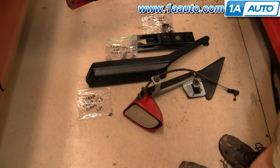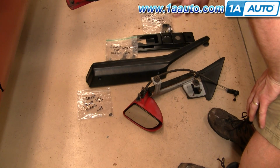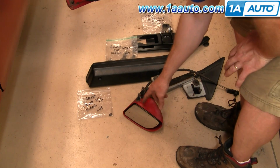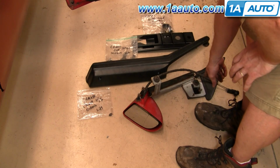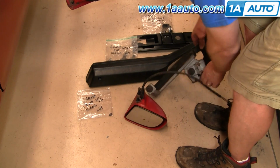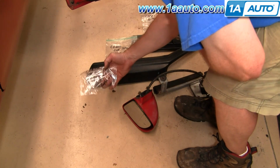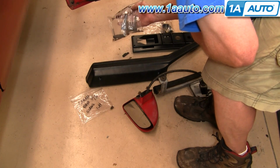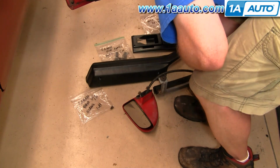Now this clip is from later after I'd taken more stuff apart, but I just wanted to show you that when you take things apart, especially in this case where we're going to take it all apart and then get it painted, I do things like I took the mirror off and then I put the nuts back on so I can find them. I put the bolts back into the track, the little triangle pieces on, and put things back together. And then I took little bags and clearly marked them, as far as maybe the door panel hardware or some of the window hardware and things like that.